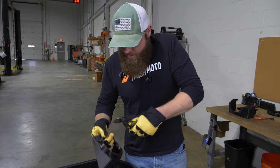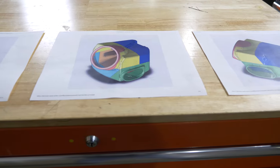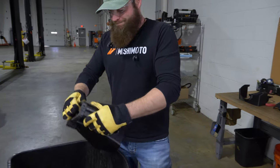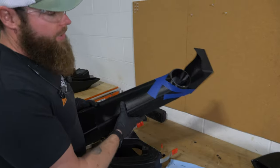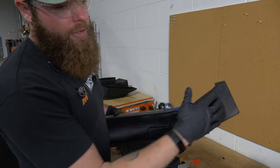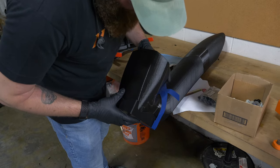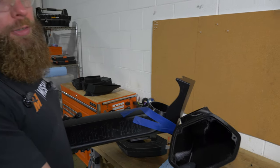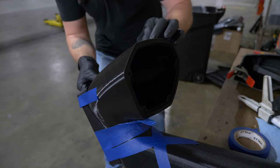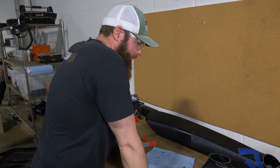What I'll do is put all these pieces together like a puzzle and make an airbox out of it, then we'll try to fit it in the truck. What we did here to help assemble this — we printed this little fixture, and what that does is it helps align the inlet. The only reason we made this was just to help glue this together to make sure it gets in the right alignment. So we 3D printed a part so we could put together a 3D printed part.